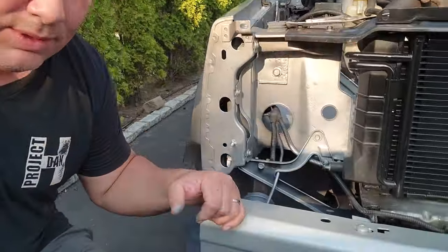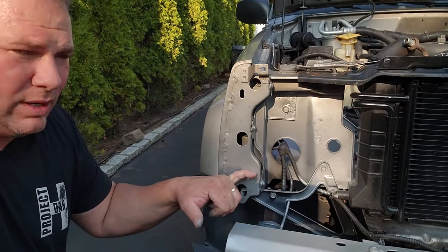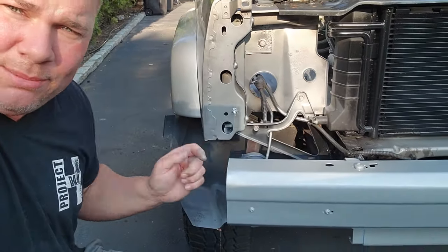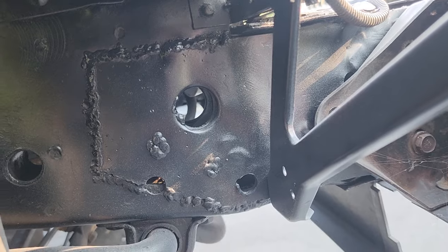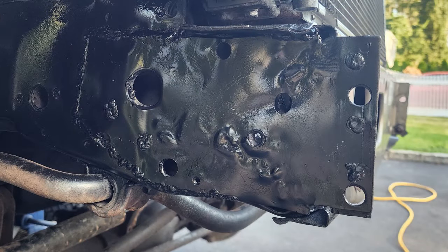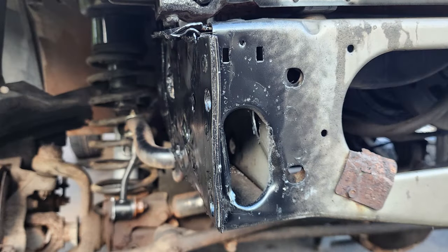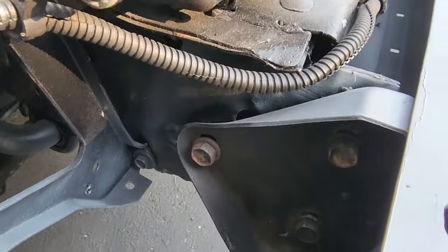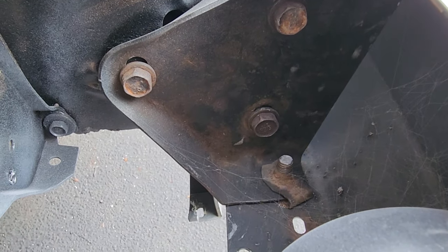While we're in the front — this was busted off, and this guy ended up breaking off when I was adjusting the frame. I welded in a patch of frame and this fits perfectly because it's factory XJ frame. It came out all right — straight enough to pinch all three of these pieces, now nice and straight. I got the bumper bracket on with factory bumper fasteners and factory clips.